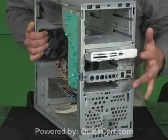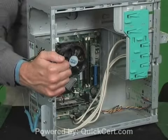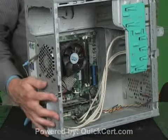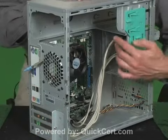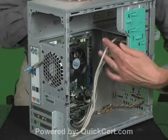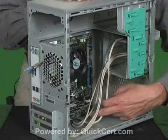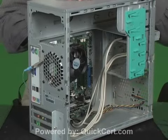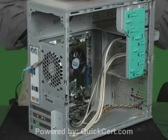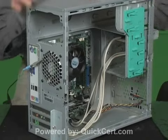The back side of these are those. This is one of the things that I would strongly encourage you to document: each of these cables, where it originates, and then where it terminates on the motherboard. Even go so far, again, as I showed earlier, to draw on a simple piece of paper a sketch of the motherboard, maybe show the location of the front, the back, and the processor, and then identify those connectors.